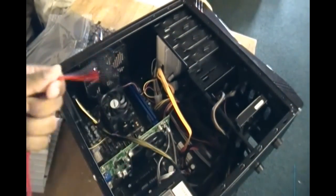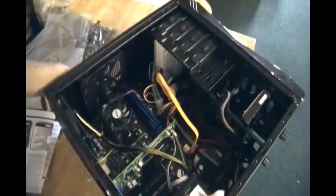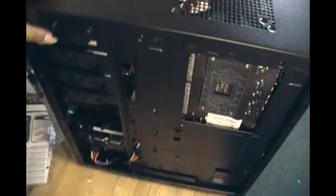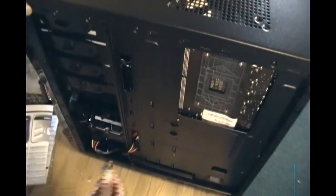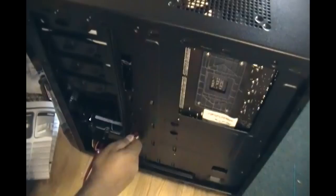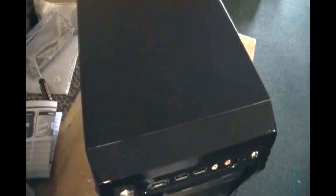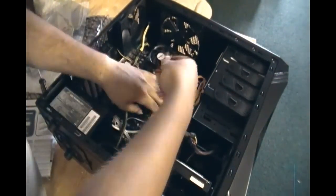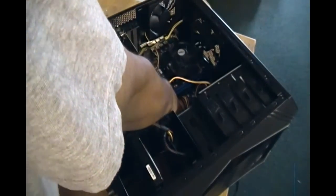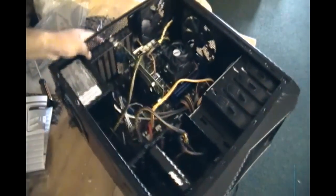I need one more SATA cable — I have this red one here. This will connect to the hard drive. Because of the setup of the case, I'm going to have to flip this around again. First I'm going to connect this to the hard drive on the back — there's a SATA connector here, you just pop it in there. It snapped in. I'm going to slip this wire through and pull it out. I thought this case was good when I saw it in the picture, but I'm not a fan of it anymore. The SATA cable slips in right there. It's not pretty, but that's all I can do right now.